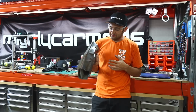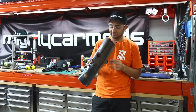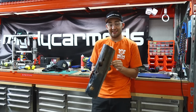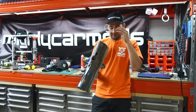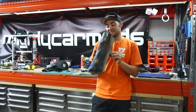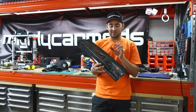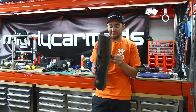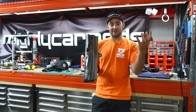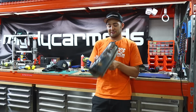A pretty good example of what an icy, snowy, and salty road will do to a little car with tiny, thin sheet metal that's just pressed into layers, which makes it quite strong, but it's still no match for rust. That is properly rusted right through. Luckily, the underside of the car isn't quite this bad. There's one or two spots that are pretty dire, but we don't need any of this because all this comes from our original one. It's literally just the suspension pickup points and a few other areas like where the fuel tank bolts in that we do need, so we can bin this.